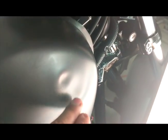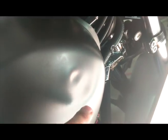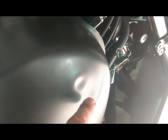That way this knows where to flow to. Because if I just go knocking down this crown right now, the whole area is going to collapse. So I'm going to create a bridge between this crown and that crown by pulling up, doing a glue pull right there, and then I will start the knockdown session and get this back to smooth again.